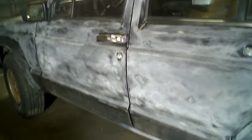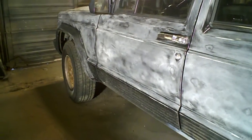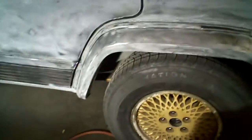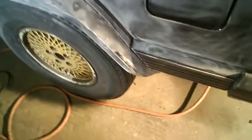For me, I have to get all of that down, bring it back down to the original paint job like I did in a lot of places here, and then I can start the steps from there. Bring it up to 320, then once I get it to 320, I'm going to throw the primer on and we'll start from there. I'll block it out, mask it off, then do the door jams. And I will be removing the wheels and removing the bumpers. I even did the back already — I'll remove the lights and the bumpers.